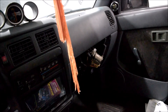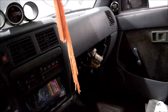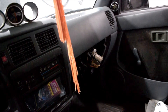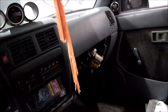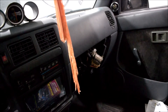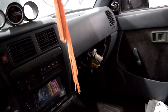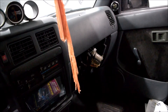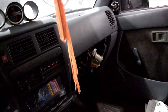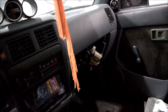At some point I tried to vacuum it out, check for leaks, and recharged it, but my compressor never kicked on. So this time around I'm not playing with this anymore — I'm replacing the AC compressor, the expansion valve, the AC dryer, every single o-ring in the system, the thermistor, the pressure switch, and even the AC amplifier board, to make sure I have a fully operational system with all brand new components. As much of that as possible will be factory OEM. The only non-OEM components will be the expansion valve and AC dryer.